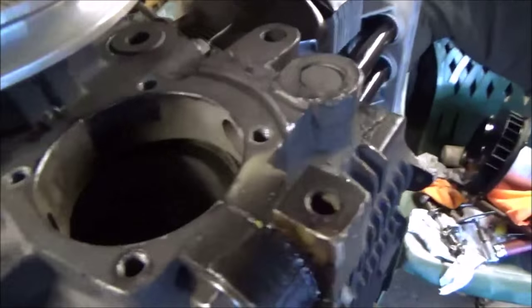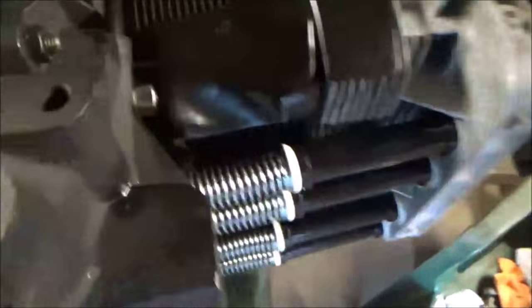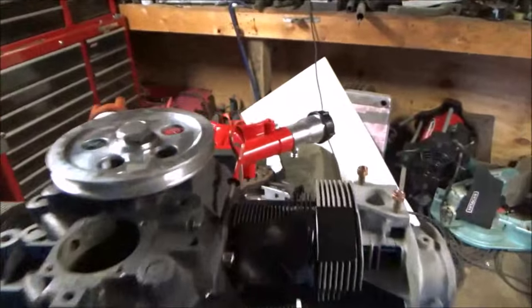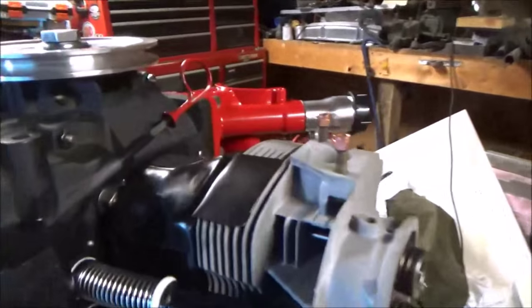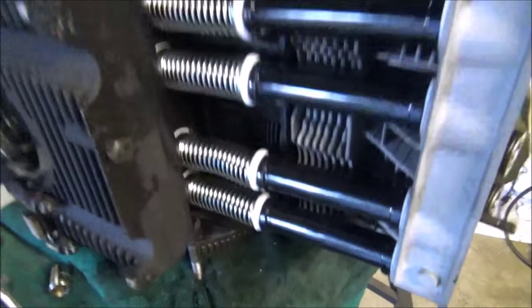I have to order another oil pump. The one that I had was for, like I said, a flat cam. My cam is dished. You see it in there, it's like a bowl. I have a dished cam. And they better get it right this time. Because I was looking at the notes and it appears that I ordered the correct one, but they sent the wrong one. So what did they do? They credited me. And that's gonna take a few days, and it's already been like a week. We know how long it's been.